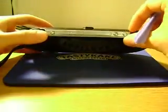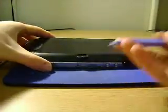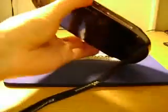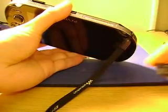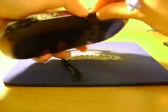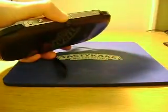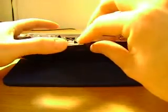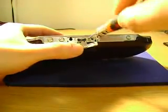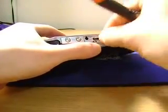The easiest way about this is to find one of the flat edges and get in there with your little iPod pry tool. I'll try to start at the bottom. Oh, it might be a good idea to take out memory cards and whatnot. Before I forget, it's a good thing I opened these up because there are actually two more screws hiding in here, plus two more on the dock connector before we start prying. Always check, or else you're gonna break something.